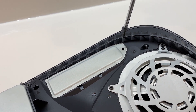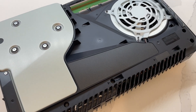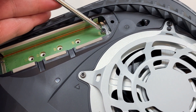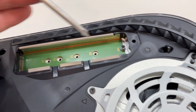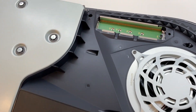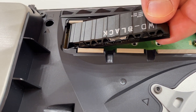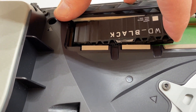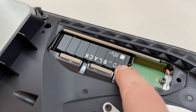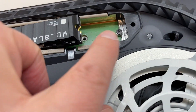This will open up the area where you need to plug in the SSD. Once you've completely opened up the SSD expansion bay on your PlayStation 5, locate the screw on the opposite end. Remove the screw and keep it aside, as you will need it to secure your SSD once it's slotted into your PlayStation 5. Now it's time to expand our storage horizons by inserting the WD Black SN850 SSD. You're going to want to take a slightly angled approach, and as you can see, when you pop it in at that angle, it's going to pop up just a little bit and naturally sit at an angle.